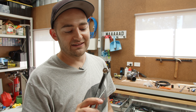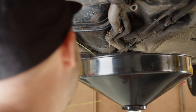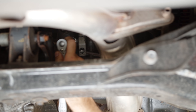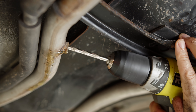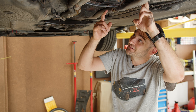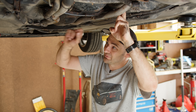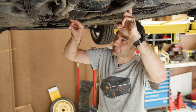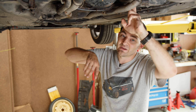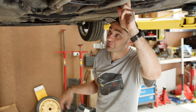The bolt that goes into the water pipe — it's lovely, zinc coated or stainless or something and doesn't rust, but it's got a mild steel bolt in it which does rust and perishes, and it took almost no force whatsoever to break that clean off. So I guess we're drilling it out. According to the papers that came with this car, it just turned 30, and the 30-year-old coolant pipes have fought back. This side came out fine, but that side has seized and got caught in there, snapped the head of the bolt, and so I've had to drill it out. Because it requires a copper sealing washer on there, I'll have to tap it out to a specific size to make sure I can still get a good seal on that surface. I don't have one, so it's probably a good time to go get some bits and come back to it when it's all here.